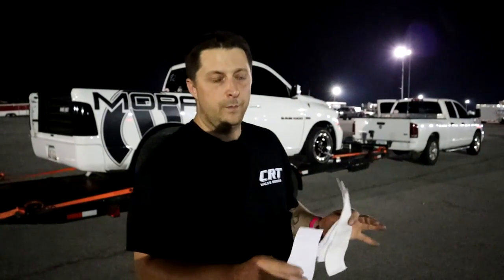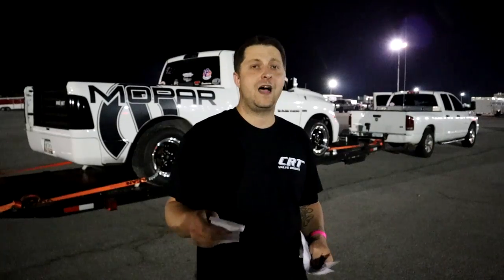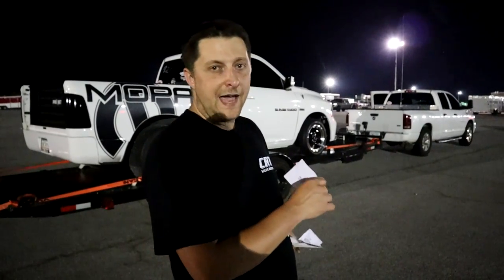But again, a lot goes into that. The biggest thing is the DA. 3100 DA, that's the worst DA I've been in all season this year with Frostbite, so that's slowing it down a lot by itself. The other thing is we added pure meth and we have to tune for it, and we knew that, so it's running really rich. It's not going to make as much power running that rich.